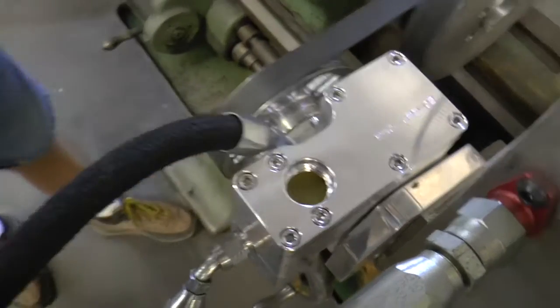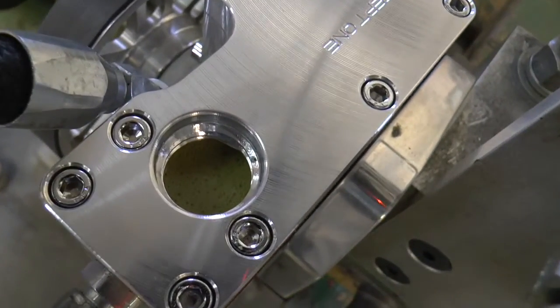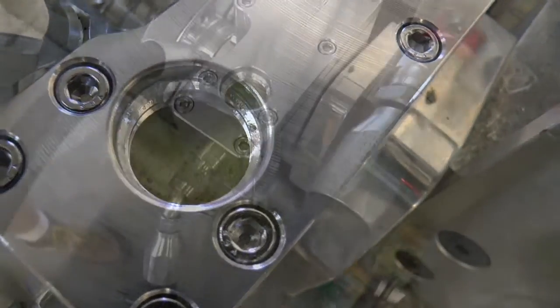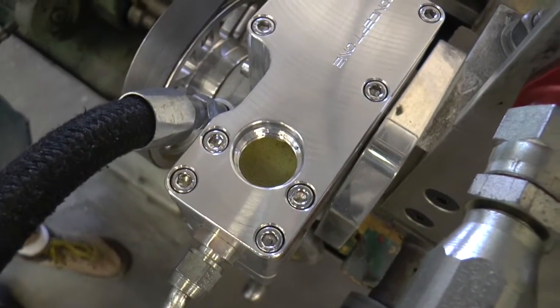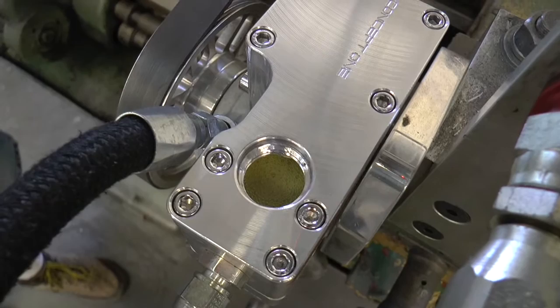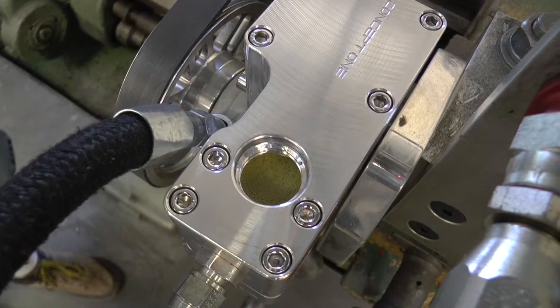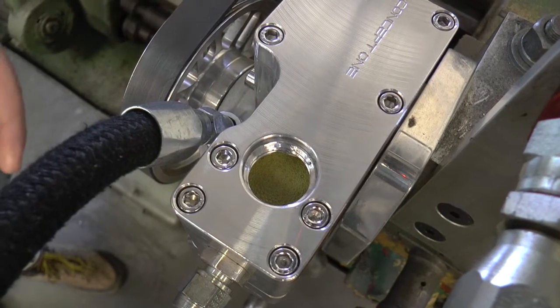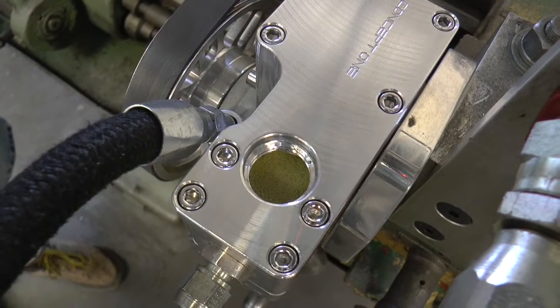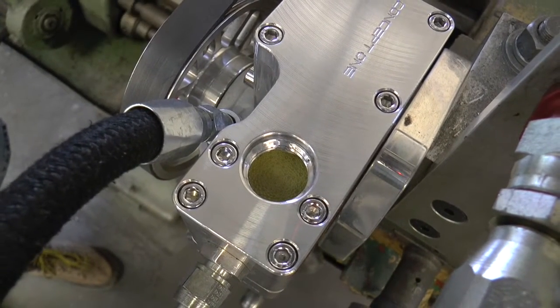Can you see the bubbles? Yep, you can see it. You can see after I turned the pump on that it created a bunch of air bubbles — that's your noise. That's what happens when this thing's not completely full: it sucks the fluid down, starts sucking air, makes bubbles, then it makes noise.